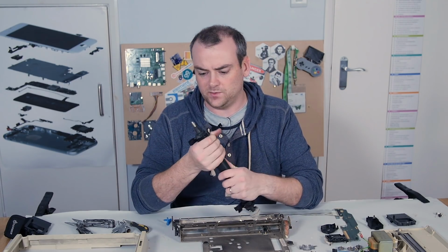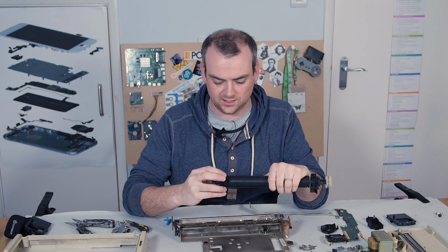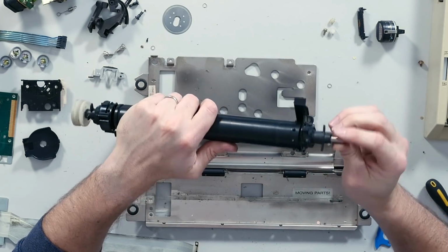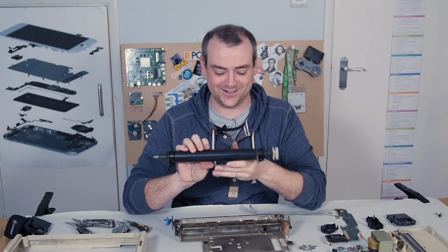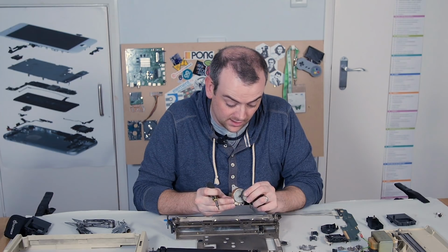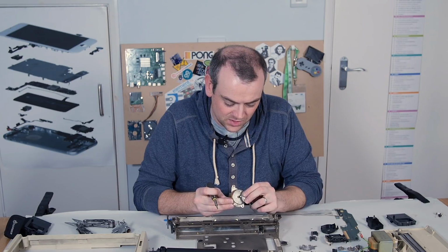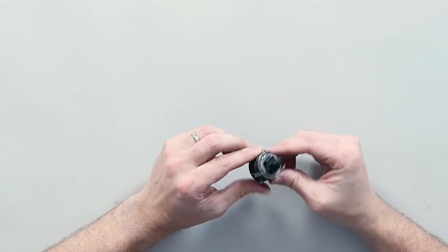So here's the main paper roller, and again you can see those tracked pins on the side. Feed that paper through. I'm never getting those pins out of the roller in the centre. So unfortunately you'll just have to kind of imagine that I've taken that bit apart. Motor's dated May 1988, and this is a 7.5 degree stepper motor. The nice normal voltage of 6.63 volts. Common.